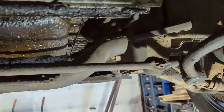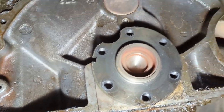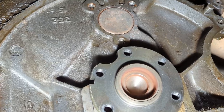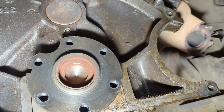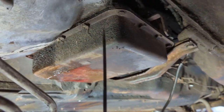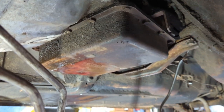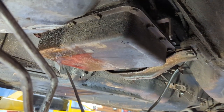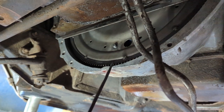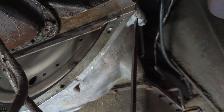While we're here, let me show you the back end of the engine too. Nothing to see here — no identifying marks, just the regular old castings. I went ahead and put the Cruise-O-Matic in. I haven't had this oil pan off yet — I'm waiting for a filter and gasket, so I'll change those when I get them. There's a little bit of wet around there from the dipstick tube. A tip when putting these transmissions in: make sure your torque bolts are in the proper holes in the flex plate before you start tightening up the bell housing bolts.